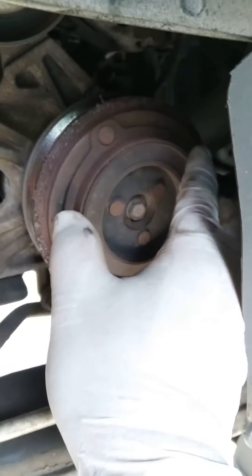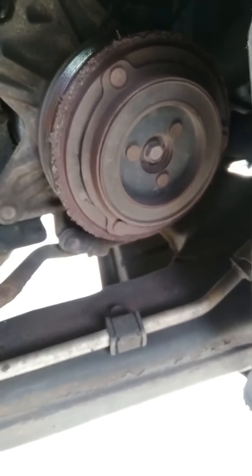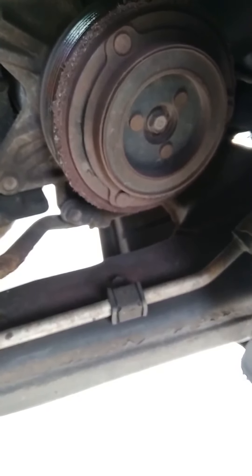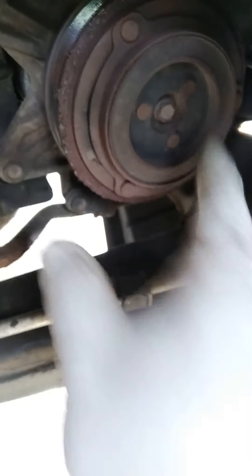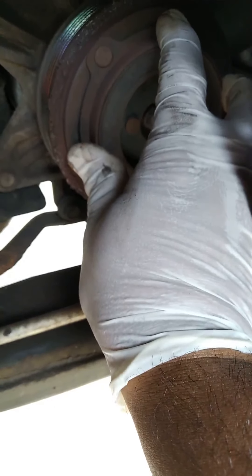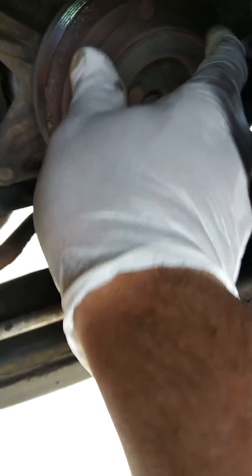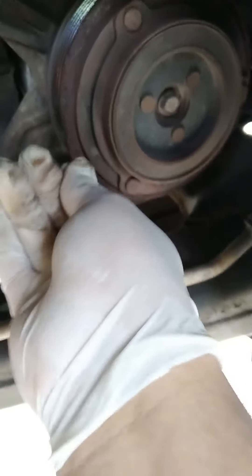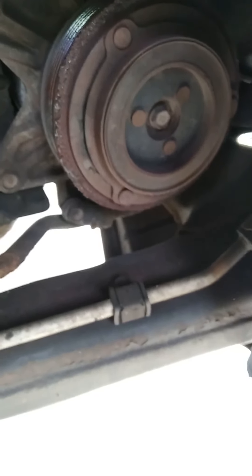You can see how wobbly this clutch is — it's pretty bad. Very important guys: if your AC is good, this fix is for you. If your AC compressor is no good, this fix will not work. In this case the middle pulley is very rigid, which tells me the compressor is 100% good. The problem is this pulley right here — you can see it's bad. That's the reason I'm going to change the whole thing.